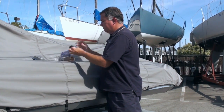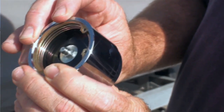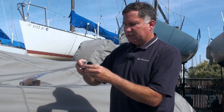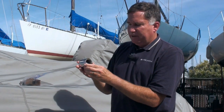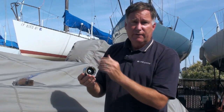These wheel bearing protectors install in the end of your hub. They're precision machined to tap into the hub, and then on this end you have a zerk fitting and a piston with a spring on it. The idea is that you put your grease gun on the grease zerk and start pumping it full of grease. As you do that, it pushes the piston out against the spring pressure. You don't want to push it so hard that there's no spring left — you want to push it about halfway. At that point, it keeps pressure on the grease and doesn't allow any water to come in when you immerse it in cold water. This also makes it much easier to re-grease your bearings, because you just put a grease gun on there and pump it up until the piston moves about halfway. Very straightforward.